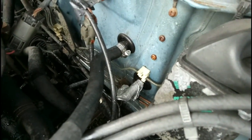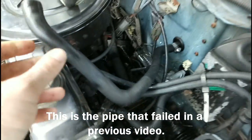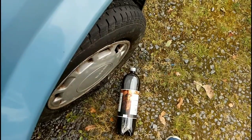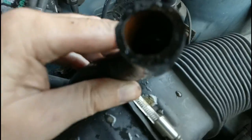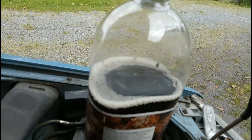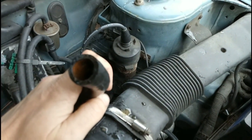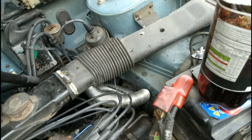I've bunged up the bottom of the matrix. I've got this pipe adjusted so I can pour some cola in — and look at that. All a bit unpleasant in that hose. I could really do with replacing the hoses, but alas, I'm probably not going to do that. Time to put my faith in Coca-Cola — not that actual brand. We've now got about that much coke bubbling away inside the heater matrix, and I'm going to leave that overnight and we'll see what we find in the morning.